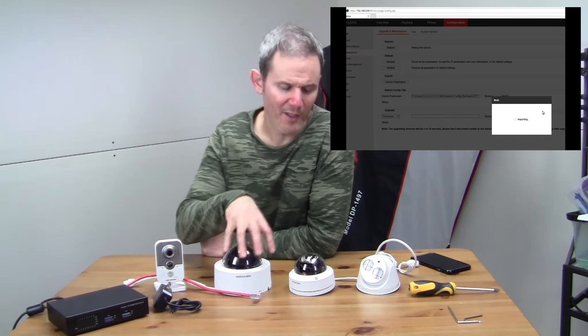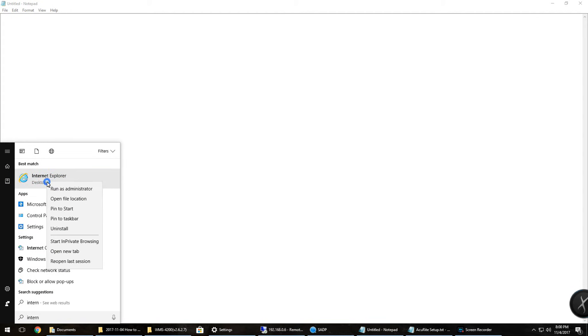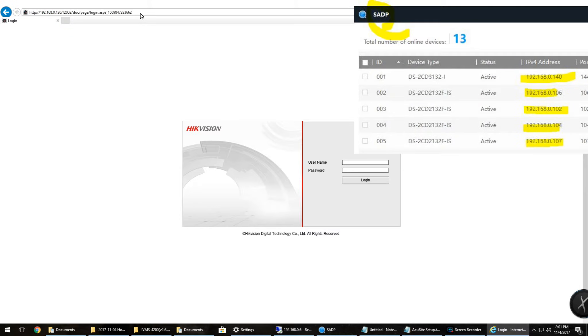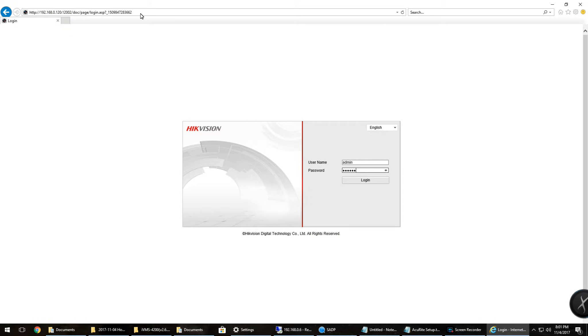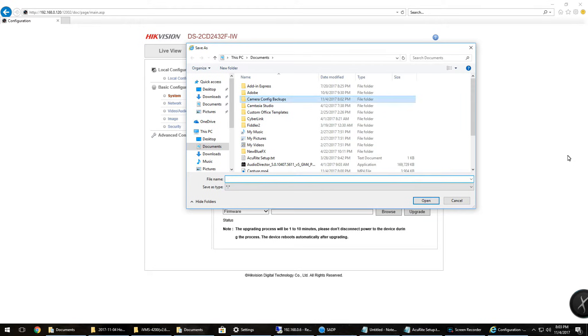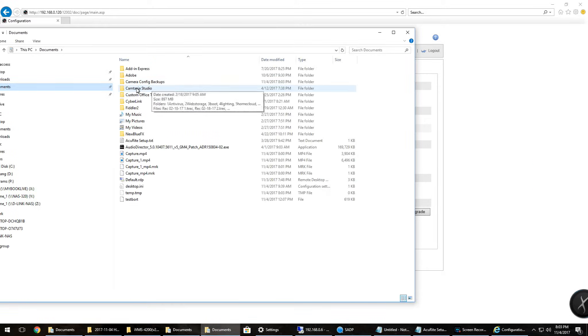Remember that a config file will not work across models — so if I have a file from my PTZ camera it won't work on any of the other models. If you have a dedicated NVR kit from Hikvision, you might be able to export the camera's configuration through the NVR menus. Here on my PC I want to use Internet Explorer, so you should run it as administrator, otherwise you will not be able to see the files in Windows Explorer. Log into the cube camera using its IP address found in the Hikvision SADP tools application, enter the credentials, navigate to the basic configuration system and maintenance tab, and click the export button. Name the file with the date and add the camera type or location so you always have the right setup for a particular area.